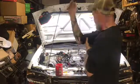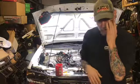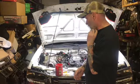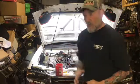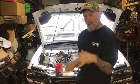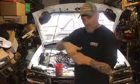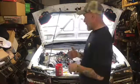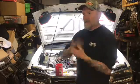I'm also gonna try and clean up some of those wires today, from the trans brake and bump install. I still haven't been able to do anything there. I want to leave the ins and outs wires out because I do believe that I'm going to go 4-port boost controller and CO2 boost control. So in other words, there's going to be a CO2 tank in the cab of the truck, and that will supply the pressure to the top of the wastegate to control boost. So it won't be using the turbine anymore or the compressor housing for boost control anymore. It'll be using CO2 pressure.